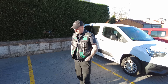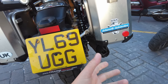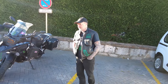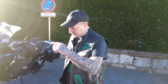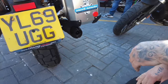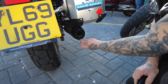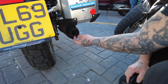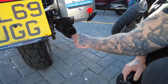See, what happened was yesterday, just as we got here, this came flying off the motorway in a ball of flames and landed. Paul and Lee literally did some combat moves to go and retrieve it off of the motorway. I did the Jean-Claude Van Damme dismount, rolled across the motorway, recovered said piece. The problem is this end can is made of chinesium, and there was a hole in the bottom of it, and basically a bolt went up through to tighten the baffle up, but it's worked loose, vibrated and made the hole massive, and all the metal in there is gone.